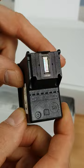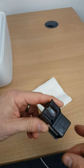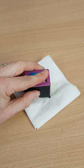This is the point where the ink would dry up. So what we do is take a piece of kitchen or tissue paper with a wet warm patch — I've just got it out of the tap — and we're going to take the underside of this cartridge and just sit it on there and hold it there for 30 seconds or so.